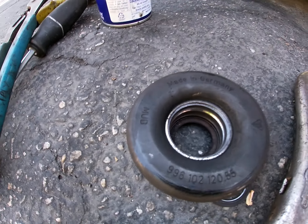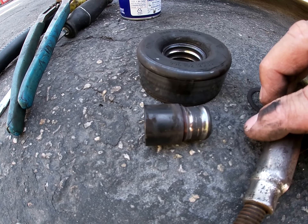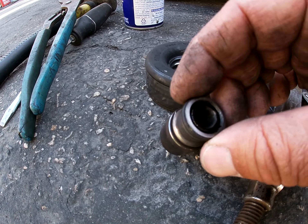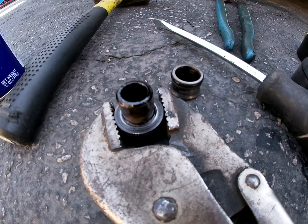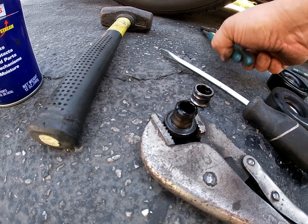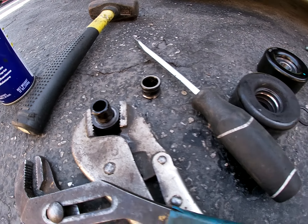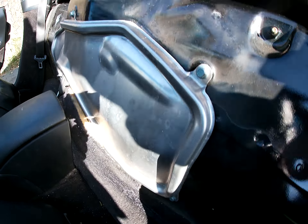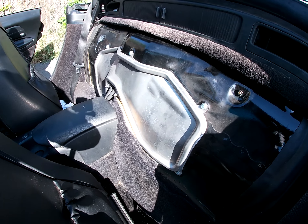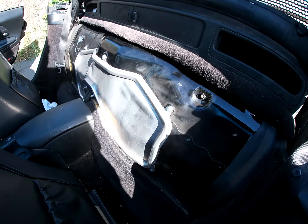Until the next day. It's another day here — even got the owner here putting on his registration. Got the belt loose, so I'm going to loosen up the pulley. Here's the new pulley — got it at AutoZone, it's a 231173. We got a little problem here though. The bearing blew up and I took it out — pieces everywhere. This piece is supposed to come off and separate so it can slide onto the new one. I'm going to spray it down with WD-40 and try to separate it. Sprayed some in there, and bam — came off. I hit it, shocked it, got some pliers and twisted it back and forth, and finally came loose. Thank goodness. We would have been dead in the water if I couldn't get that out. So let's put the new one on and see if the noise is gone.